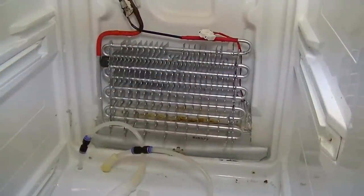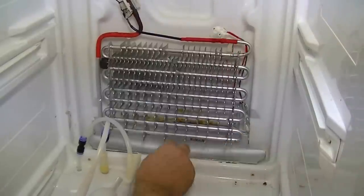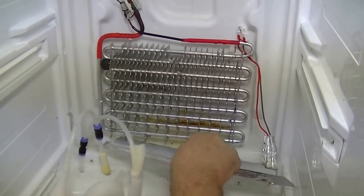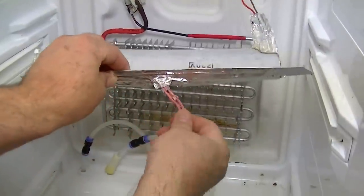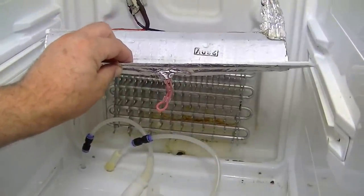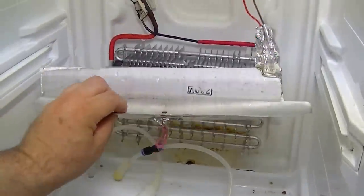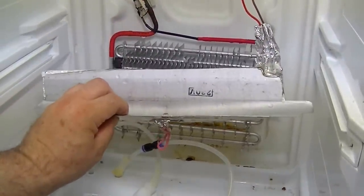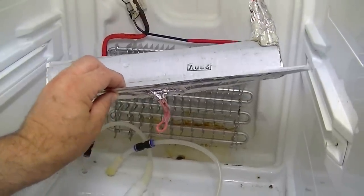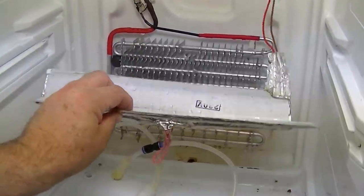The last thing on this cooler is the drain heater. Basically just pop it out. Make sure the little pink wires come out of the drain hole — those are the little pink wires and they're supposed to go down the drain hole. What they do when the heater is working properly is keep the drain hole clear so no ice builds up. If you're trying to remove the drain heater and it's quite resistant, it's probably because there's still a lot of ice in the hole and it's freezing the wires. Again, make sure you pour hot water or steam down. Once you've got it all clear, this will lift straight away.